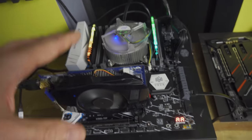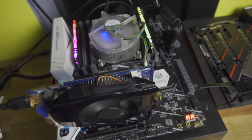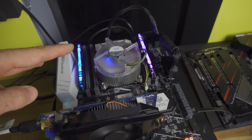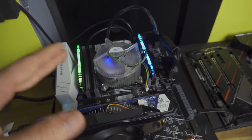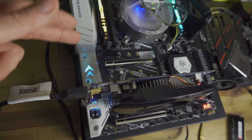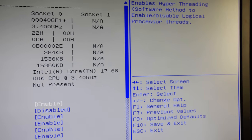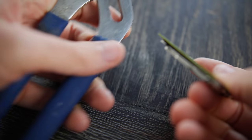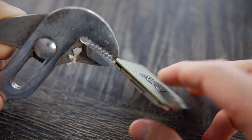After spending some quality time with this CPU and motherboard, we have got this thing to POST. You'll notice two of the DIMMs are missing, so we've only got two DDR4 DIMMs in this board — in slots one and three — so slots two and four have been knocked out by the missing corner. The top PCIe bracket doesn't work either. Since this is a 6800K it doesn't have all PCIe lanes available, so the second slot only runs at x8 even though this motherboard has an x16 slot.